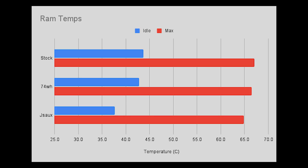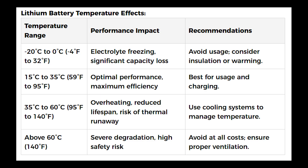Let's look at the RAM results first. The RAM chips of the Ally are rated up to 80 degrees Celsius and for none of these mods did the temp actually come anywhere near that, so the RAM chips are fine. These are the acceptable temperature values for lithium batteries. The higher you go above 35°C, the faster the battery will degrade, and the closer you get to 60°C or above, you start getting into dangerous territory. The aim of our mod is to get the battery to a safe temperature, but the lower we can get it, the slower it's going to degrade.